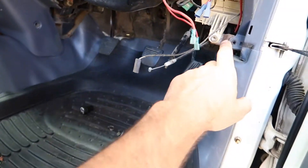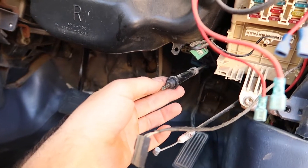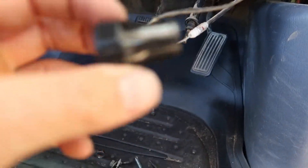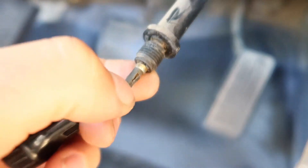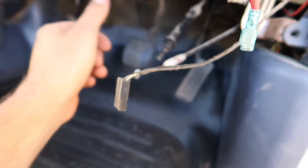I removed the panel from under here — there's one bolt and then several screws, plus a cable that clips out. The throttle cable just has a small tab: push in a tiny screwdriver into that hole and you can pop it off. Then use a 14mm socket to undo the nut and it slides out of the panel.